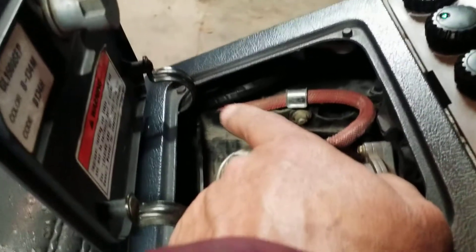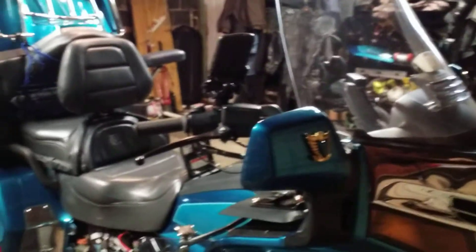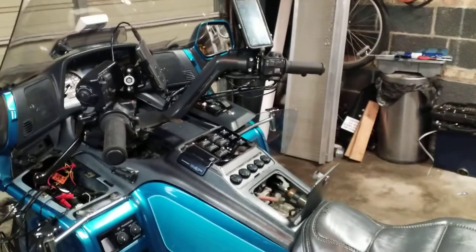That's how I did the electrical wiring. I basically routed it with the seat off and the middle section of the fairing and top deck off, routing it around the side. It goes right past the gas cap and you can even see the harness down in there — a nice new clean harness, not interfering with anything and not in a particularly dangerous place. All the parts totaled less than $500, and it allows the bike to do everything a modern bike can basically do, except for fuel injection. Any questions, just ask — take care.